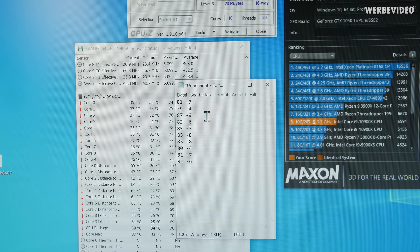On the second run, as expected the temperature difference is a little bit smaller, simply because there's more heat still in the water cooling loop - I ran it after about two minutes, while the initial run had 15 minutes of idle beforehand. Overall, we see minus four to minus nine degrees Celsius difference, so about seven degrees Celsius improvement overall. That's very much similar to the 9900K and previous soldered CPUs with liquid metal - nothing unexpected. Six to eight degrees Celsius is what you can expect.